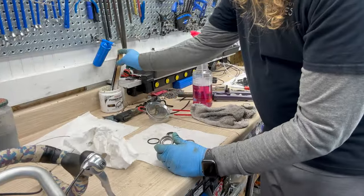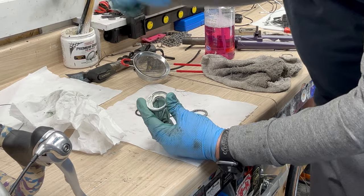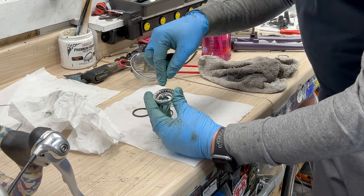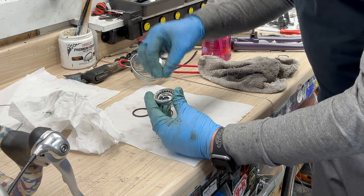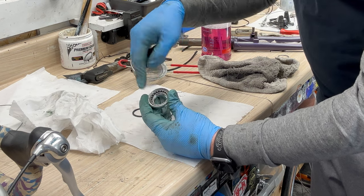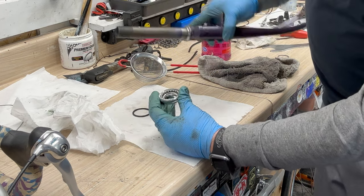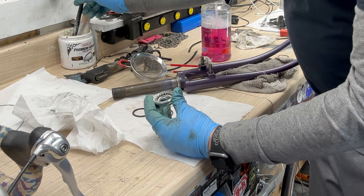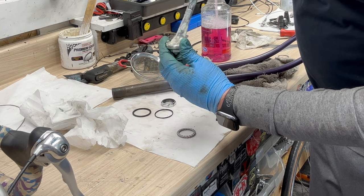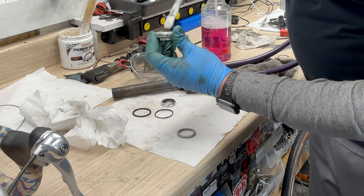Okay, once they're dry, first, put a nice coating of grease here. And the ball bearings, that cone, this is the race going to the cup, you want it to be like a bullet going in. So the ball bearings are going to be externally, and that bullet portion goes through like so. Once you get that in there, the race itself is up against the cup or the crown.